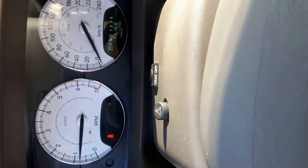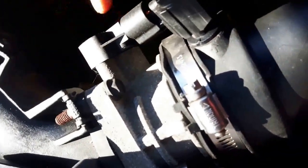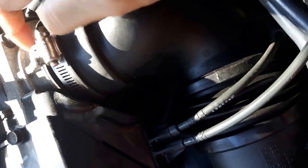Shut the car down and let's go under the hood. This is the 2.7 liter. This is the air filter, this is the intake. We'll clean the throttle body — there's the ICV valve. From inside we'll clean it; another day I'll show how to open the ICV valve and check. First, check if this tube is sitting properly on the throttle body.